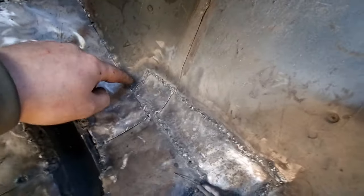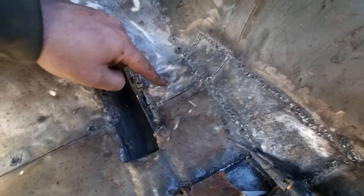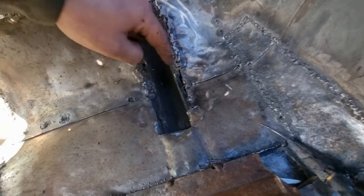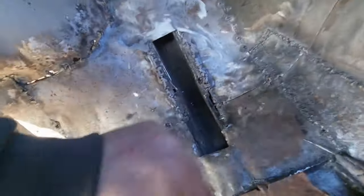That's got the lip — took it straight across there, butt welded it in here. I'm going to put a bit of weld and then grind it down so it looks like part of the lip. Still loads of grinding to do but I've got to put a couple of spot welds in here, some more spot welds here, and then seam seal this lip — and then this will be very solid.